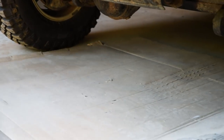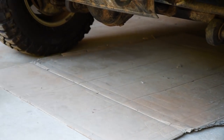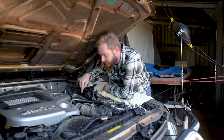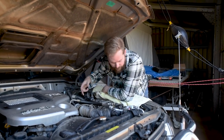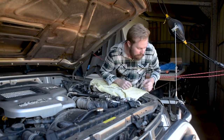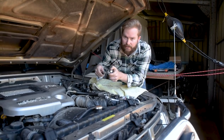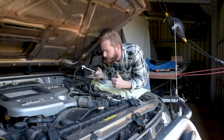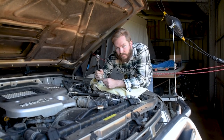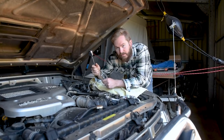If you're going to be servicing your car in your shed, you want to put something under it — there's always going to be a few drops of oil getting everywhere. If you can't do that, do it on your neighbour's lawn. I don't have a guard mask, so there's an old towel to protect my paintwork. Down underneath the turbo is the oil filter casing. If you can't undo it by hand, there is a half-inch square drive hole in the end of it, so the end of that ratchet will fit right in there — thumbs up to you, Nissan. You don't need a proprietary oil filter remover. You'll also need that half-inch drive ratchet and a 22mm socket to get your sump plug off. We'll start with the sump plug and drain this oil.